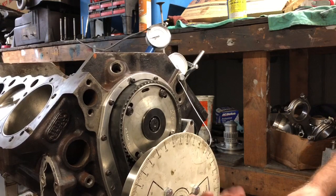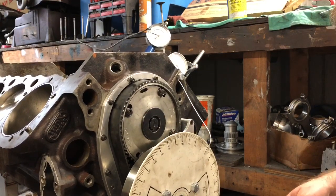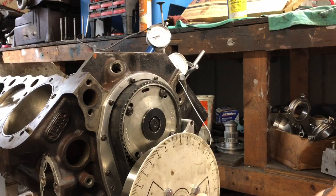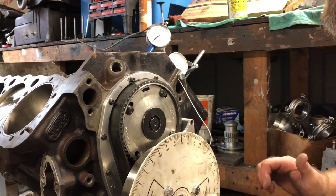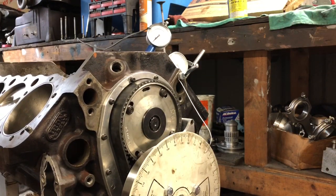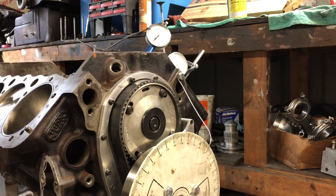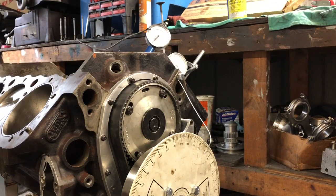This reading is the one that's varying a little bit because it's going right by it. There might be a spot on the camshaft that's a little out of round — maybe it got hit with a broken connecting rod. This camshaft has been through some hard times but it's stuck around. That's dead on 50 and right now I'm at 148. So 71 and 148.